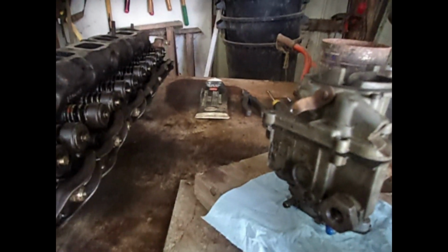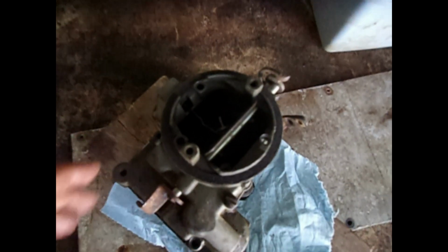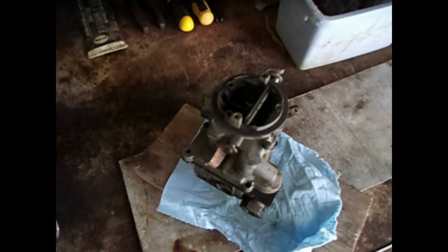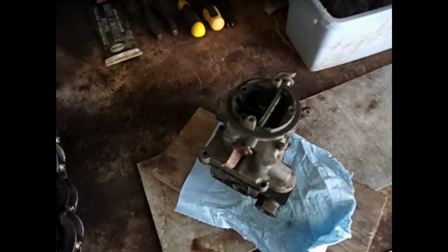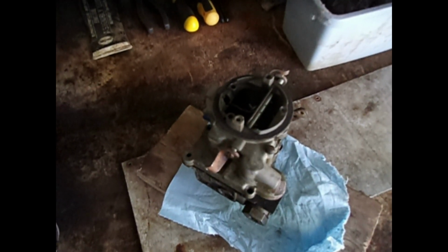The problem turns out to be, I looked down the throttle here, and it was not squirting gas down the throttle when you stepped on the gas, and so of course it won't start unless you added gas or starter fluid. So I must have messed up the accelerator pump assembly, or I perhaps didn't get the passageway cleaned out enough. So we'll do a test next.